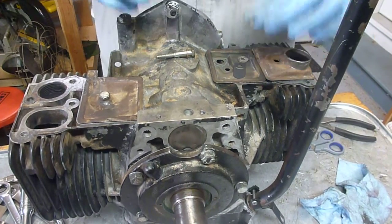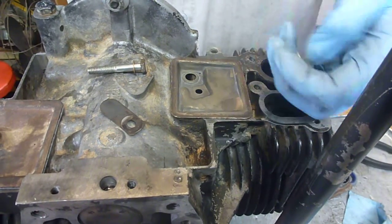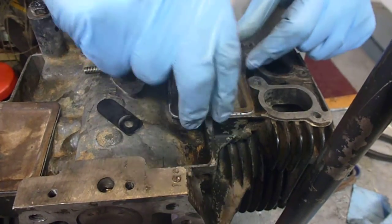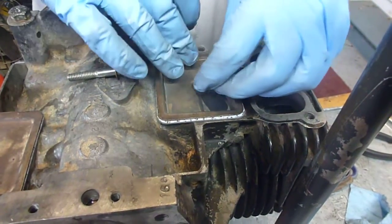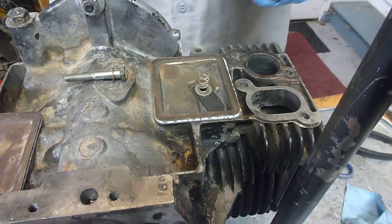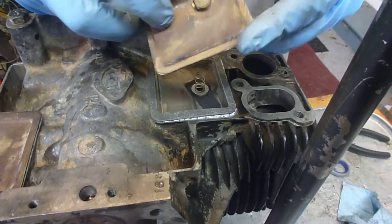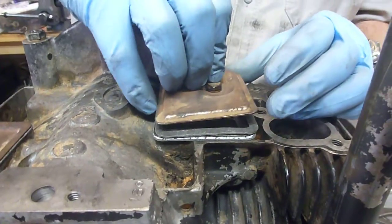When it comes to doing the breather side, we need two valve cover gaskets in this case. We need a gasket for the bottom underneath, so we're just going to match this up like that. Then we're going to put this in here like this because it lines up with the hole. Then we're going to put our reed valve in, then our washer, then our spring. Then we're going to put our gasket on the top just like this, and go ahead and put our valve cover on, going through the reed valve and everything.